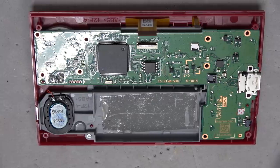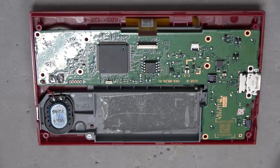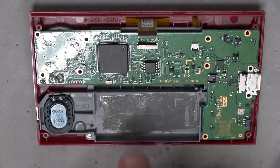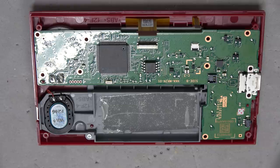It's actually an ARM Cortex-M7 with double precision floating point unit, and it runs up to 280 megahertz. That should be more than enough to emulate a Nintendo. I could probably emulate Super Nintendo. Let's see, embedded flash memory of 128 KB. Okay, that's probably why they have the external EEPROM, because there's probably not enough for the emulator and some games. On-the-fly decryption of OctoSPI external serial flash memory, which is what that is. And it has an LCD TFT controller built into it with dual-layer support.